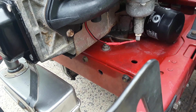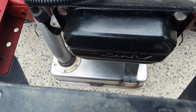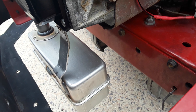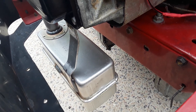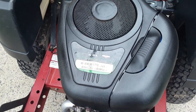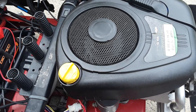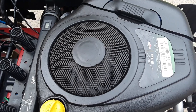That was rather easy. I also had to find another exhaust — there's the exhaust there. The exhaust is a Craftsman/Husqvarna exhaust, part number 137352. Obviously these part numbers will only be relevant if you've installed a Briggs & Stratton engine. If you installed a Kohler or Kawasaki or one of the others, you'd have to find a remedy for the parts that hit or didn't fit.